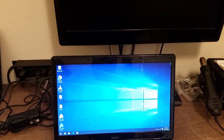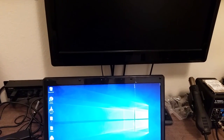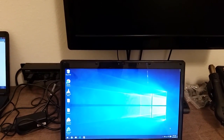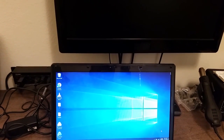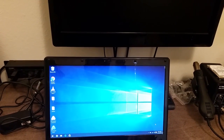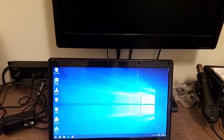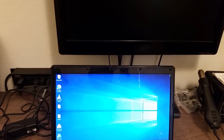What I'm going to do in this video is show how I set up a laptop computer to be a home theater PC. This is a laptop from a previous video. I added a second hard drive to it by placing a hard drive into a caddy which then replaced the DVD drive in the laptop. So this computer has a 120 gigabyte solid-state drive as the C drive and also a hard drive for extra storage.